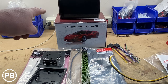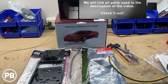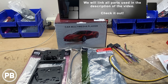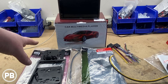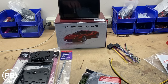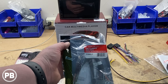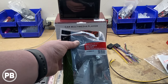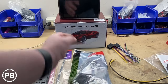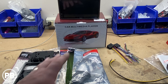It was picked up for around $140. To accommodate this new radio in the factory location, we need a dash kit — this vehicle calls for the Metra 95-2001. If you're doing a single DIN dash kit, it's the Metra 99-2001, but we're using the double DIN version. We'll need an antenna adapter — we're using the Metra 40-GM10. And finally, this vehicle calls for a smart harness; the Axxess GM Class 2, it's the LC-GM-RC-O1. It retains your chime and basic features like accessory illumination at the radio.